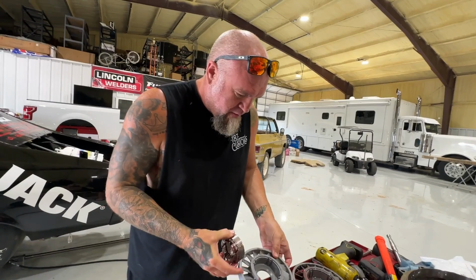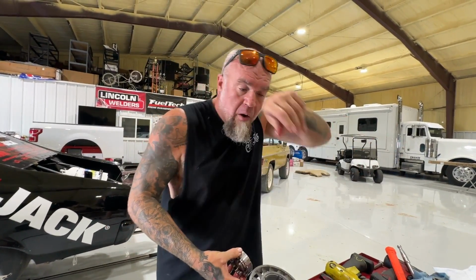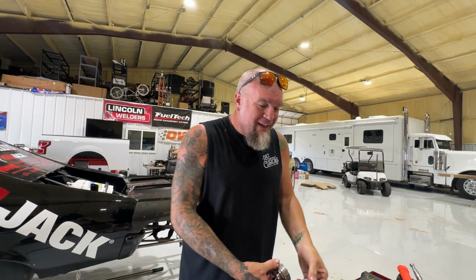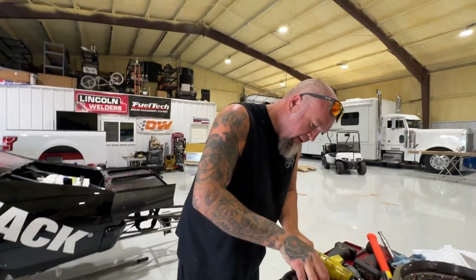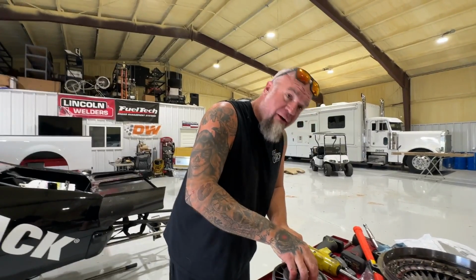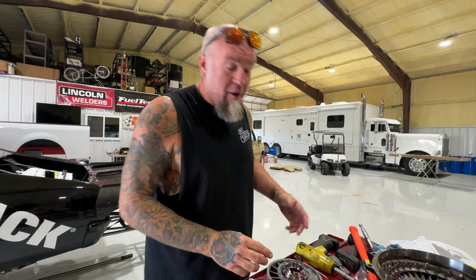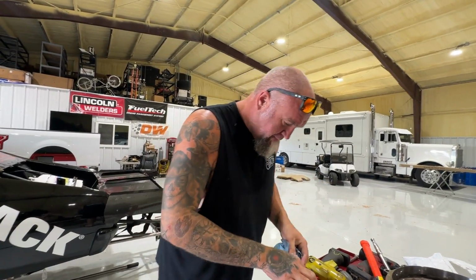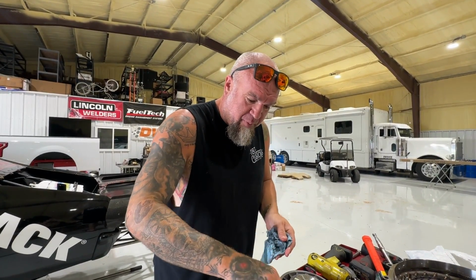So what is our thinking here? Looser, we're trying to get gone faster because we're going to slow down a little out the back, right? Or not necessarily? Not necessarily. This is supposed to be looser early to where we can apply more power without upsetting the tire. Oh, perfect. Basically, that's what we need. Yeah. Right now we're not out 60 foot in all these cars, and we should be. And that was like our whole reason for going Pro Charger, or at least 90% of it. Yes. But that's probably their reason for going Pro Charger too, all these people that were racing.